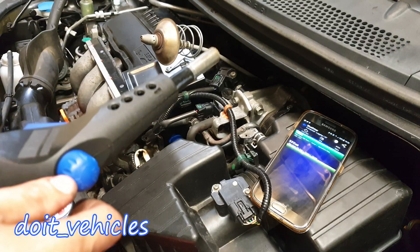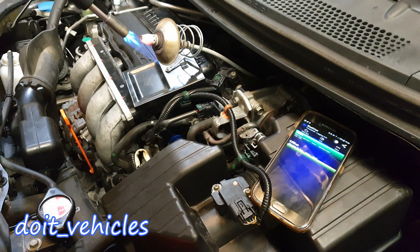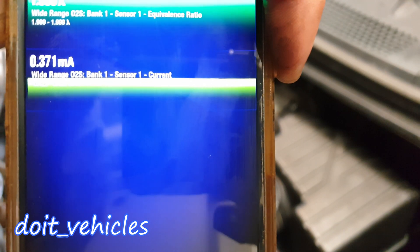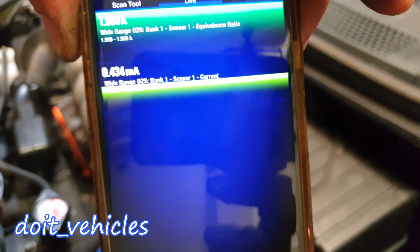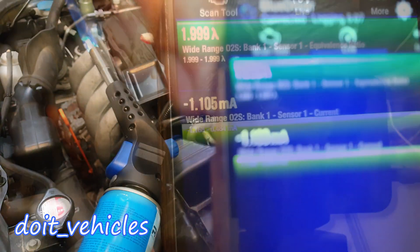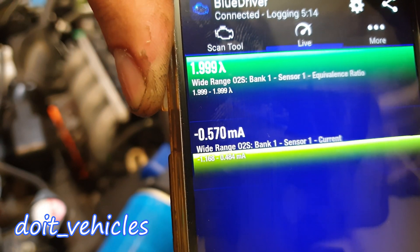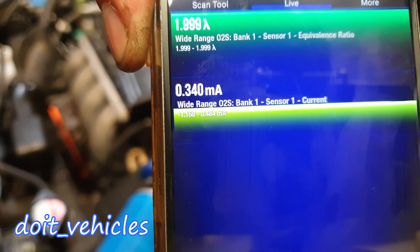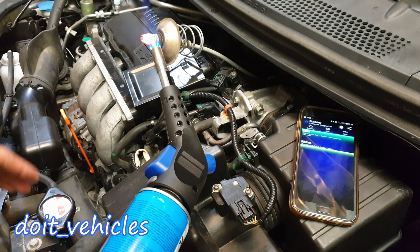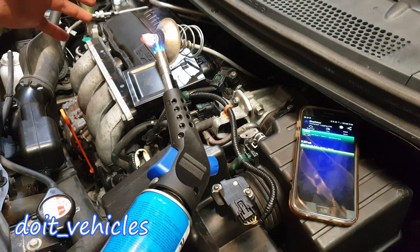So let's see. I'm going to heat up the sensor with a torch and you should be able to see the sensor going rich. The air-fuel ratio is reading a rich condition when the mA are going up, and you'll notice when I blow on the sensor these values will go into the negative pretty fast. Now I have the torch on it and it is going up. Hopefully you can see why this oxygen sensor is called a wideband oxygen sensor — because it can read a lot of values and more precisely how much air or fuel is going into the exhaust.